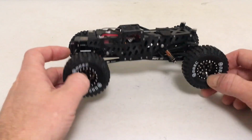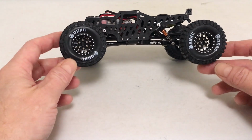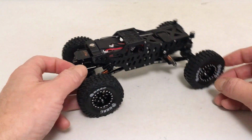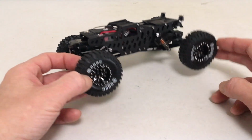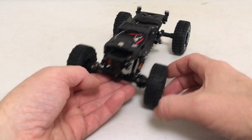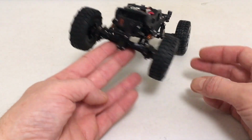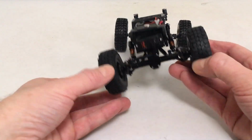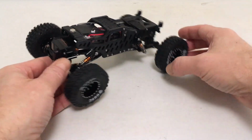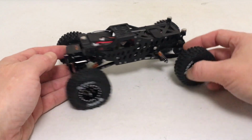So I've got a little torque beast in there right now. To get a little more wheel speed and alleviate a little strain on that motor, you can see here I swapped to some lightweight wheels and tires. These are aluminum wheels with glue-on tires, these deep dish Gunk RC wheels, and I think they look really good. Super huge offset, probably the deepest dish standard rims I've seen. Since this does not have any extensions, that gets these wheels and tires away from the shocks when they're leaning, so at full lock I'm not getting into that.